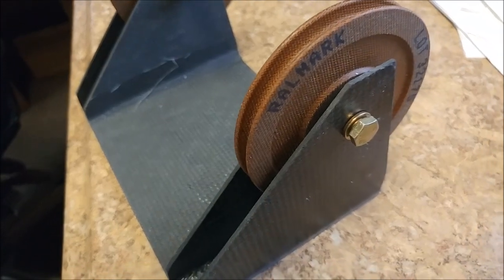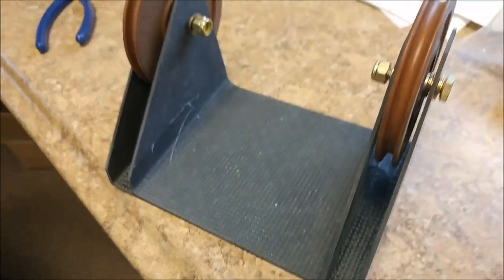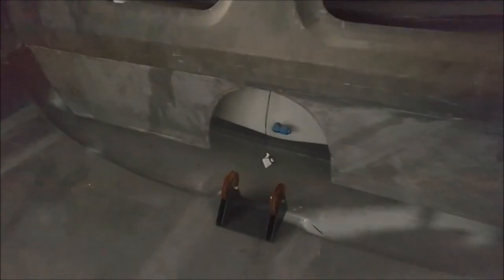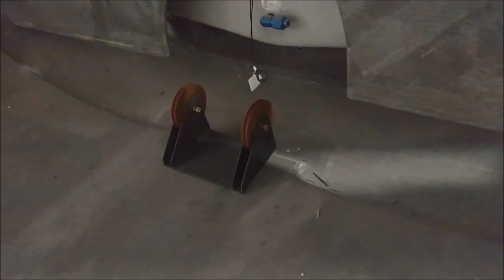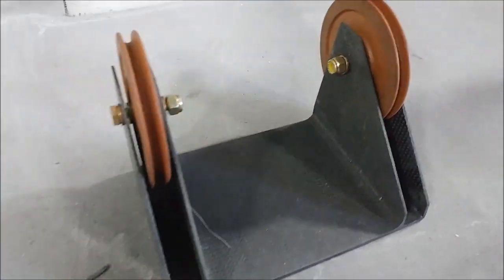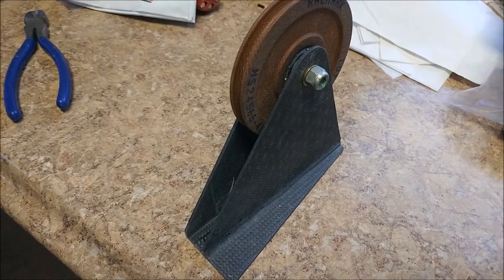Here's the first of these brackets — one for the ailerons that lives under the keel. You can see it already has pulleys mounted in there; those pulleys come with bearings and there's some hardware loosely in place. This shows where it lives in the back of the fuselage. The cables will come from the forward part of the cabin, up behind that bulkhead, to another pulley above, then forward to where the aileron control goes through the keel up to the sticks.